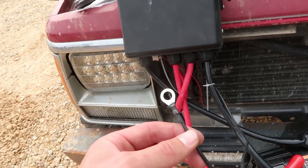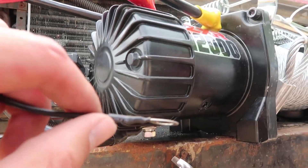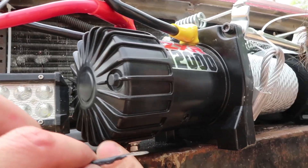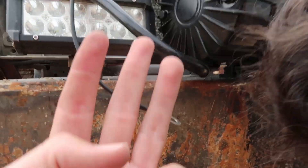The one thing we forgot: there's a little ground wire for the control box, and this needs to go on the ground point for the winch, which also runs directly to the battery. You could run it directly to the battery, but it's just easier to run it right here. That's what we're doing — it's the third time we've taken it off.